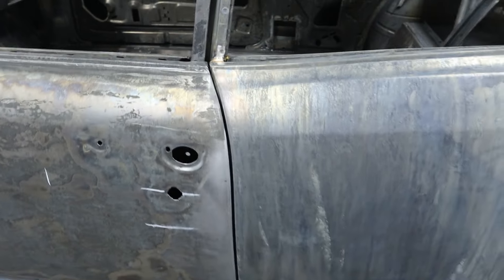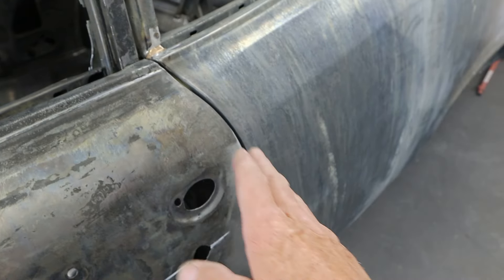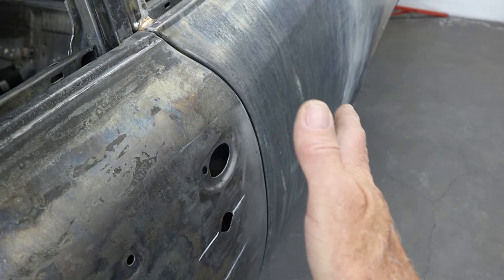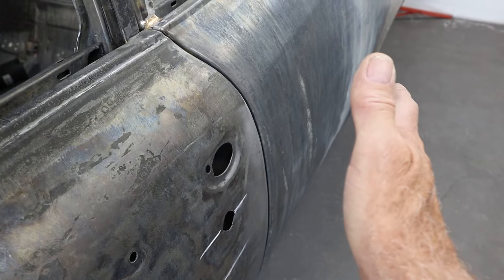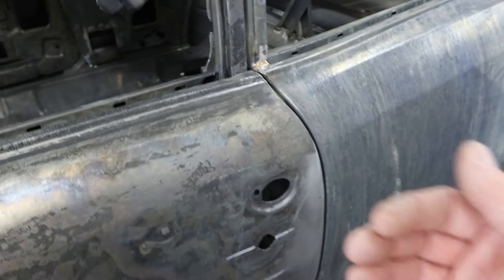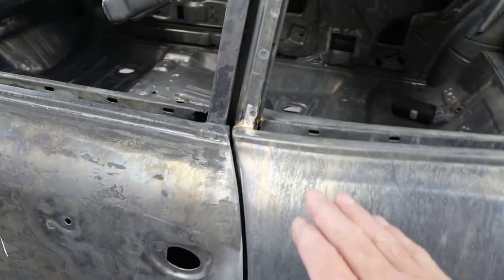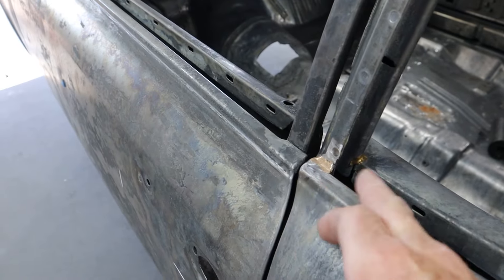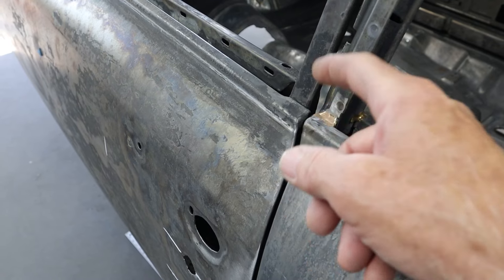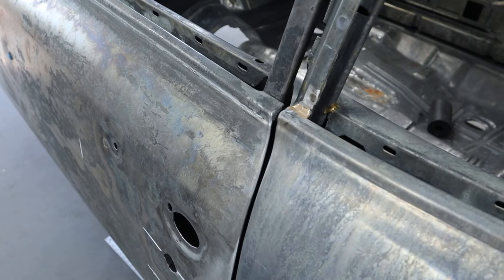What I'm going to do is not cut it loose at the top and not cut it loose at the bottom. We'll open the door, I'll put some chalk marks on here, figure out where our cuts need to be, and we'll cut inside the door jamb and put a kerf. Since that needs to go in, hopefully the kerf will be wide enough and we'll just push on it, tack it, push on it, tack it until it matches the door. Up here this does not line up — it's actually too far in where the rest is too far out. So once we get that worked out down here I think we'll cut my TIG brazing off, cut a little bit down the edge, pry that out, re-weld it, and then these will line up really nice.